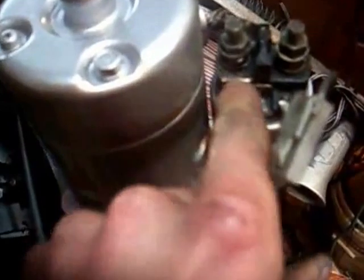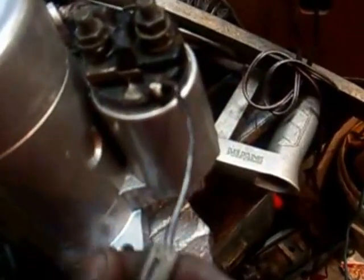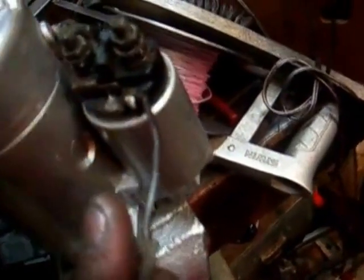Okay, so the last thing I thought I'd better mention is, number one, if you need to note which way the starter solenoid went around, this particular one went with this metal bit here to the back, or to the starter connection. And number two, what was number two? Oh yes, sorry. You need to clean up all these connections as you go. Once the paint's dry, because I've just given it another spray, as you can see it looks quite nice, I'll get the wire brush and brush them off to make sure they're all nice and clean.